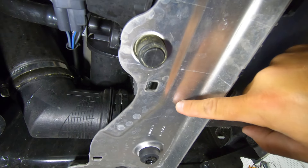So we have our recirc valve up here on the driver's side of the intercooler, passenger side on the other end. The fan basically lives on top — there's a big elbow on top that sits on the intercooler. The rubber feet from the fan fit on the inside mounting holes, and the rubber feet from the intercooler sit in the outside ones. When you go to reinstall everything, it'll take a little patience, but it's easier to see how things line up outside the truck so you're not surprised.